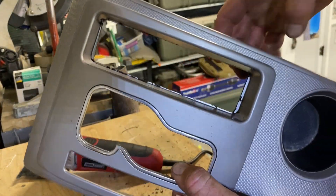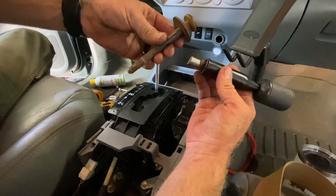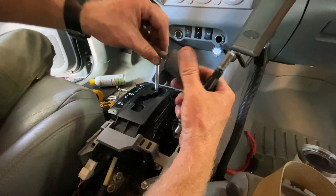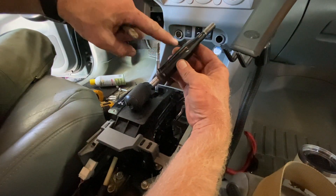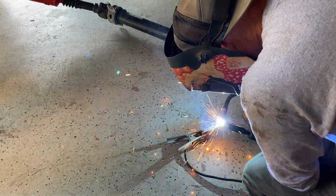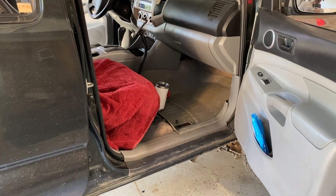I managed to forget to press record again, but I've got the factory FJ handle that I cut off and also a bed bolt out of an old Tacoma. The thread pattern is the same. My neighbor Rick mentioned I might want to keep that bevel depending on what kind of boot I'm going to use. The concern is that this material is too thick for the small size of the center console to get full range of the shifter. I've got that factory FJ shifter and I welded a four-inch seven-sixteenths grade eight bolt to it that I had laying around. We'll try that in a minute.